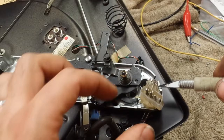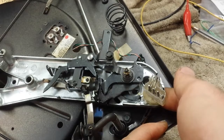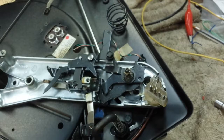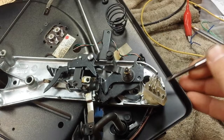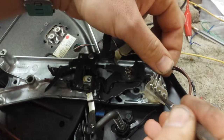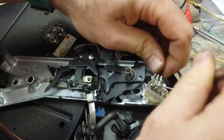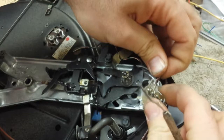Then you're going to want to take loose the wires that attach to the power switch. You can also take the entire power switch loose if you've got one of these plastic ones with the clips on it. Although if it's brittle, be careful because you can often times make a bad situation worse. You can either use a small screwdriver or a dental pick to get them up and out — they're a bit of a pain. Sometimes it's helpful to get the wires up. Let's try the dental pick method. Assuming I can get it under there. Nope — you're stuck.